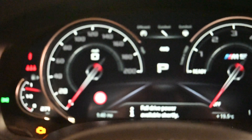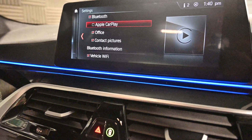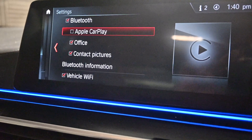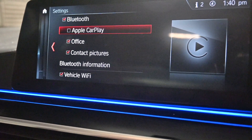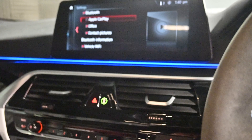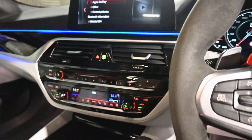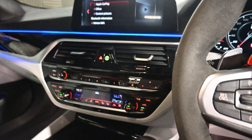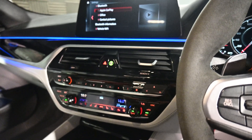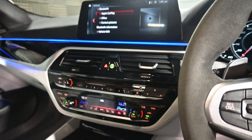Now if you're going to be flashing with your mobile phone, chances are you have Apple CarPlay connected. You're going to need to turn that off. If you leave CarPlay on and it's connected to the device you're using, you could be midway through your flash and it may decide it wants to use CarPlay instead, causing the flash to the ECU to fail. This is also true if you're at home and have a nearby router — go into settings and make sure auto-join is turned off so it doesn't jump to a different Wi-Fi connection mid-flash.